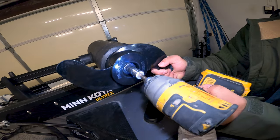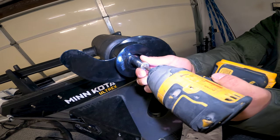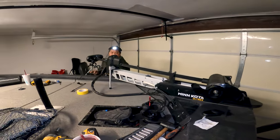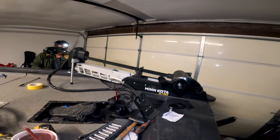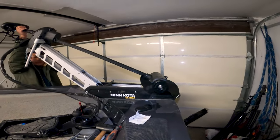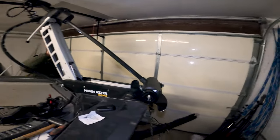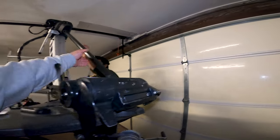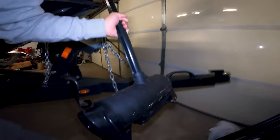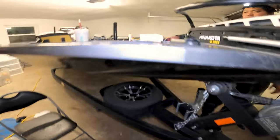Hold the prop. Yeah. No, it won't deploy, that's right, because it's in the folded position. It's not like the old school trolling motor where you can just press a button and it goes. These new ones, they have a mind of their own. Yeah. We gotta help it out. Ready? Alright.